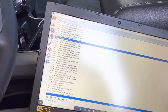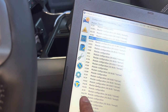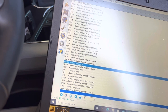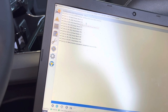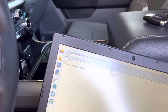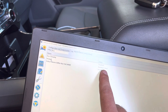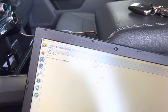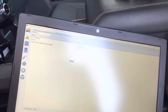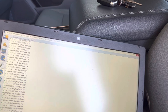Then go back and we're going to go to the body control module — that's going to be body CM, the non-as-built. Click on that and run it. You want to put it to a hardwire input — change that, it should be disabled or something before — change it to hardwire input, write that, cycle the truck on and off, then close everything up and we'll give it a try.